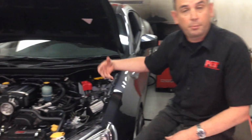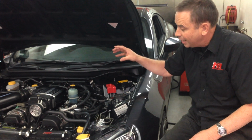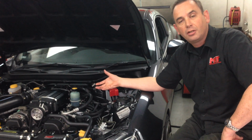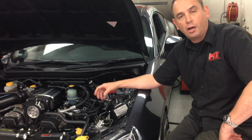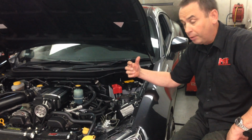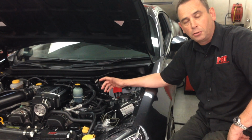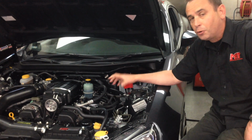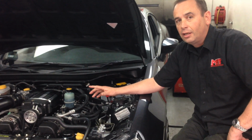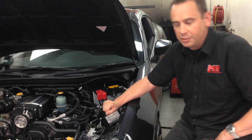What we're talking about today with this particular car is the difference between the smaller supercharger and the larger supercharger. People are looking for more grunt, more updates, more opportunities, but remember, what we're talking about here is a fully built engine that is designed to take more boost than even the modest increase in boost of the original small supercharger base kit. Remembering also this kit runs the Laminova charge cooler in the inlet manifold. So we're not at any time talking about the EcuteK supercharger kit without the charge cooler. Everything we fit always uses the charge cooler, and you can watch our other videos about that.